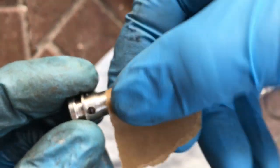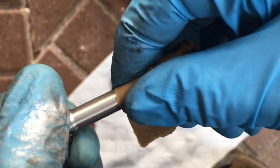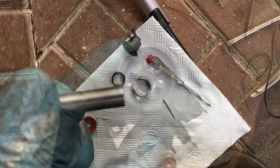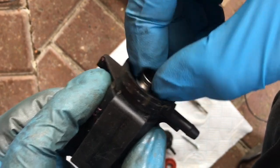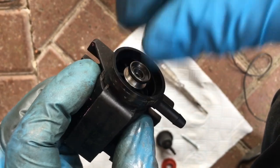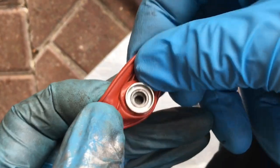If you have any rusty marks on the shaft of the solenoid, use very fine sandpaper to rub it down — anything over about 2000 grade, some people use 5000, is enough to just take off the rusty stains. Make sure when you clean it up that the rod for the solenoid moves in and out without sticking. There should be just a little bit of resistance because it forms a partial vacuum at the end which bleeds past the side of the rod — it should be nice and free. Refit the diaphragm on top, making sure it's straight.